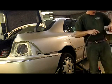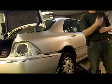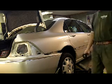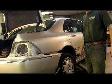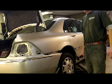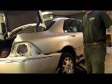I had the water dripping right out of my fitting, and I opened up the motor guard, shut the air off to it, opened up the motor guard filter, and the little toilet paper element in it seemed a little wet, and I could see a little moisture inside of it.